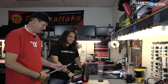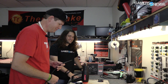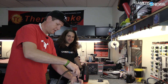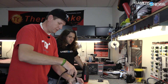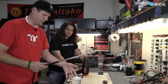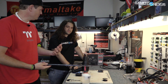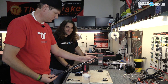I'm definitely very excited that you guys are here — really cool to be able to give you the opportunity to do some hard tube bending. So this is a PETG tubing, pretty durable stuff. You're not going to really run into issues with this, but it is also very pliable, so you can mold and shape it to give a really cool design for your next liquid-cooled PC. And this here is just regular soap with water — nothing special. It works great because it helps prevent evaporation of the water inside. You can use other stuff, but this cleans up the best, and your hands are usually pretty clean afterwards too.